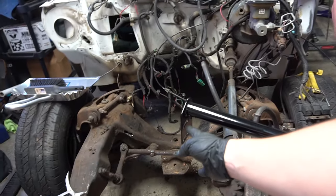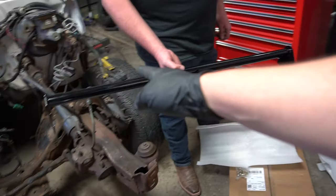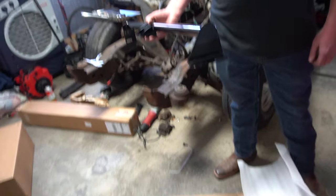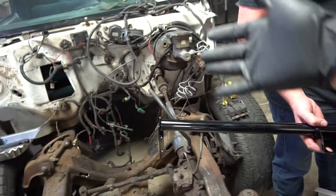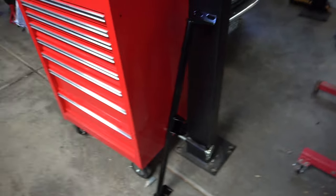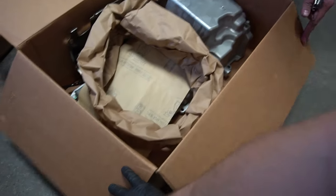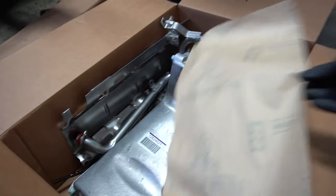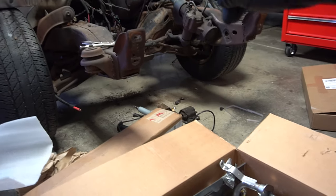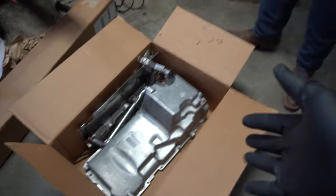Nice simple piece, bolts right into the factory spots, and it has sliders on everything. If you move the engine in and out you can also move the transmission crossmember back and forth. It's all powder coated, so between those mounts and this transmission mount it pretty much makes it a drop-in bolt-in deal. The trans mount also came with hardware so we don't have to use any of the stock stuff. This is a muscle car GM swap pan - supposedly the one that works with LS swaps. As long as Google did me right, this one should go in without having to notch the K-member.